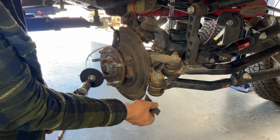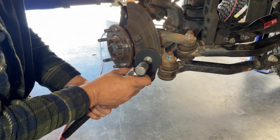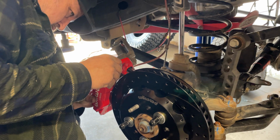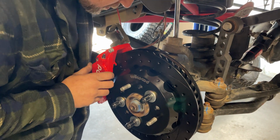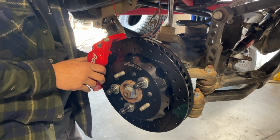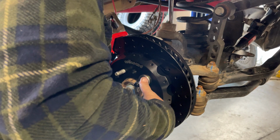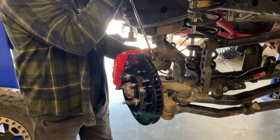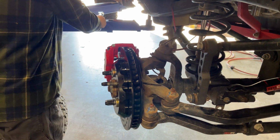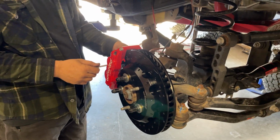After cutting off a small portion of the dust shield that was interfering with the rotor, we ground off any rough edges. Once this is completed, we mount the caliper onto the wheel hub for the first time, and we make sure the caliper is oriented so that the largest piston is at the top of the caliper, or what is considered the rotor exit end. We added some lightweight oil to the bracket studs first and then placed 2 shim washers on the caliper bracket studs and then temporarily tightened the caliper down with locking nuts.